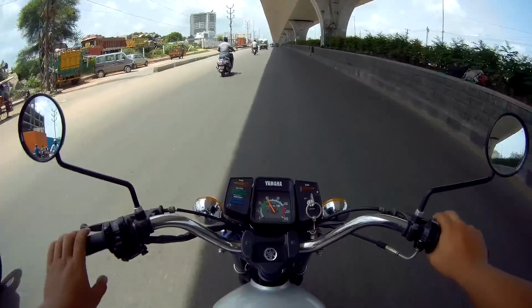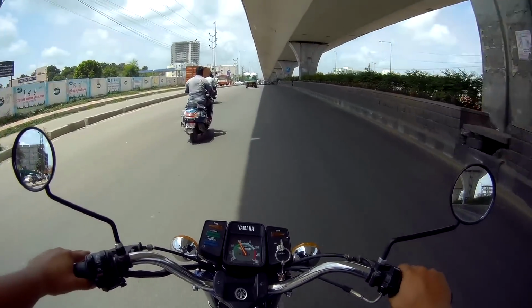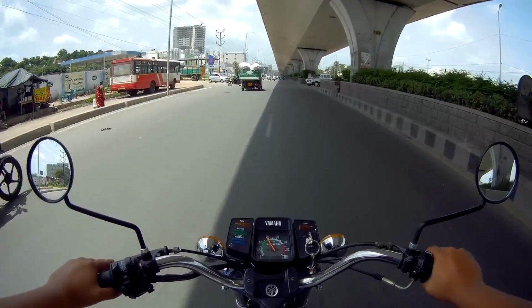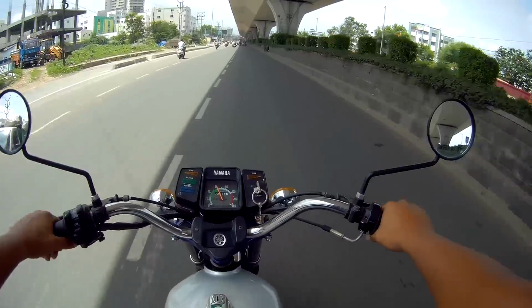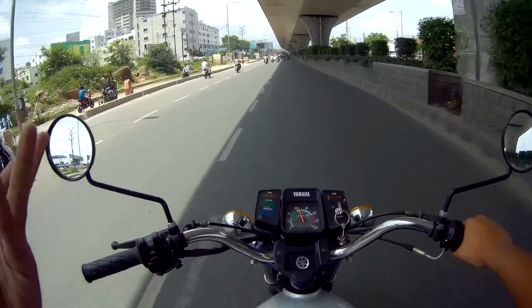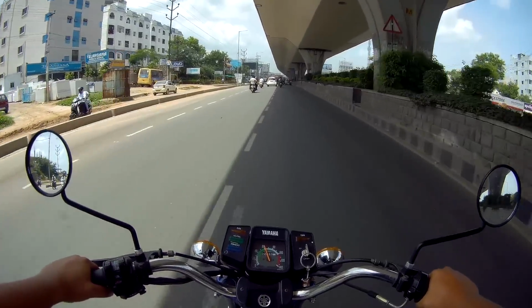And for longevity of the engine, as you all know, you have to mix oil with petrol in these bikes, so make sure you use good oil. For 100 rupees of petrol, 15 of oil, one 40 ml sachet. It's a little bit higher than usual, but because the engine is ported, use it in that ratio. Too much oil and your plug will get burned, too less oil and your engine will get fucked.